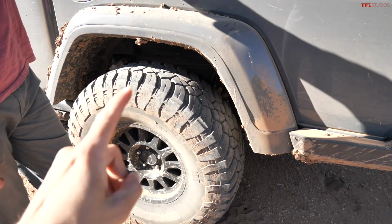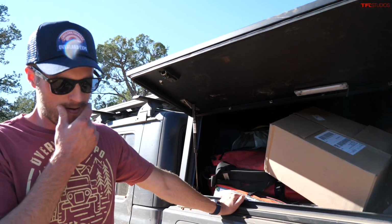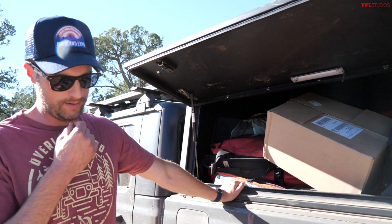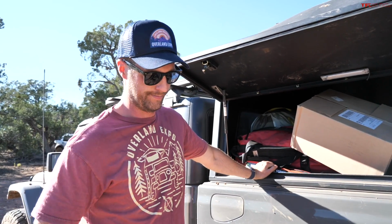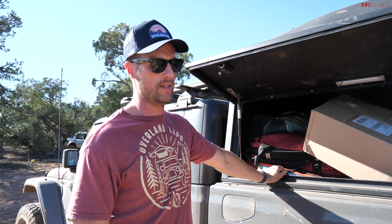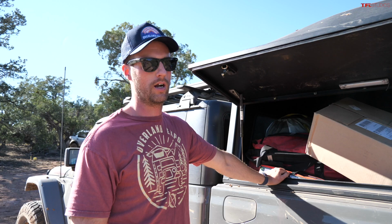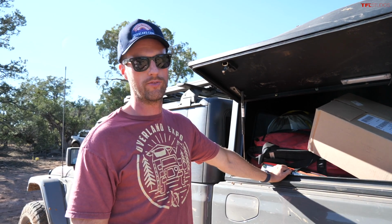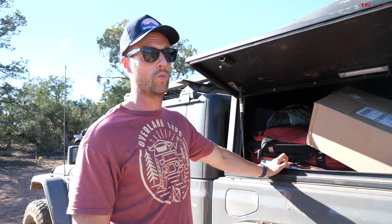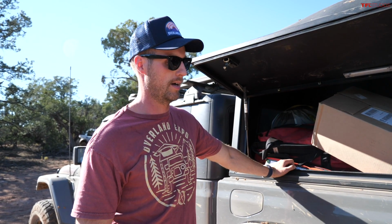So when you were speccing out the suspension, did you do a different spring rate for the amount of weight that you figured you were going to be adding, or have you just made those adjustments in the shocks mostly? Here's the issue right now. Nobody yet, other than AEV, and I don't know what those are rated to, really has a constant heavy load spring for the Gladiator. Clayton is working on one and ARB are working on one, but nobody else has one on the market.